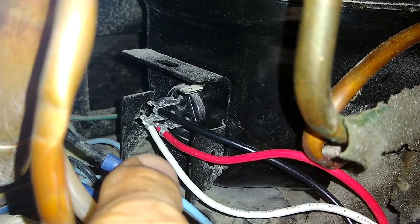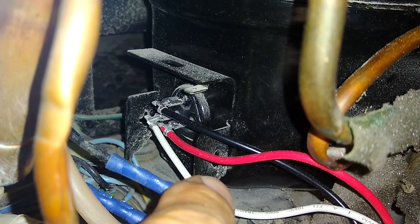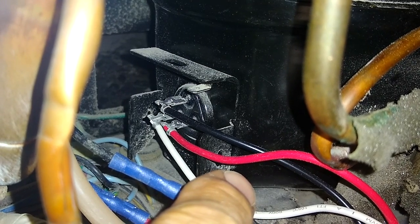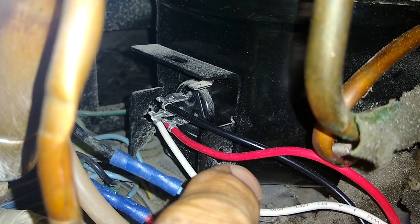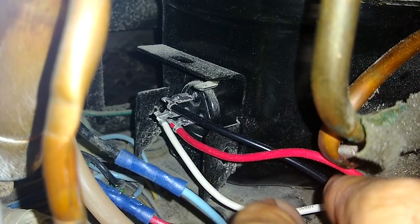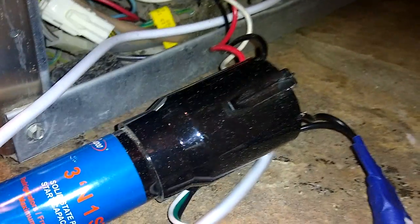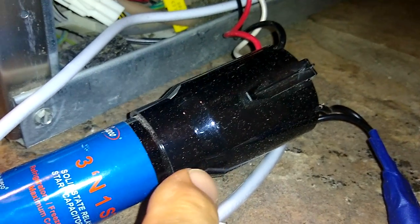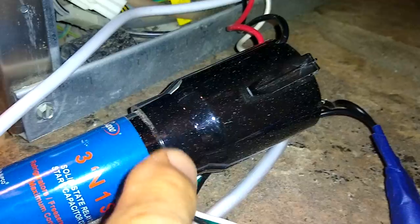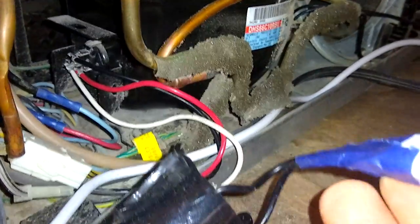And then the other white wire, the one that's the lower pin closest to the inside of the refrigerator, opposite my finger, that wire gets a momentary connection to the same wire that you have connected to the red wire. So you would just tap that pin to that power wire, and the compressor will start, and the compressor will continue running until you unplug it from the power or use a switch or however it is that you're turning your power on and off. So with or without a start capacitor, you can start your compressor in your refrigerator.